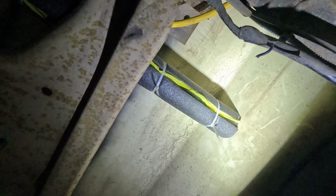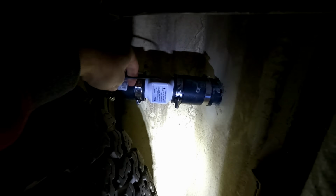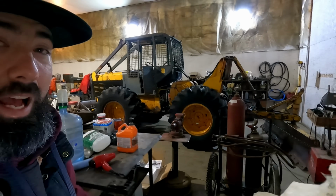So this has been a whole lot of trial and error with heavy focus on error, unfortunately. But this is my tube coming down. It's all nicely insulated. And rendition number 1, we just had the tube going back to the compartments back here, and it didn't have enough pressure to blow the hot air all the way. So on Amazon I found this little 1.5 inch vent fan, and I wired that in to the other switch. This switch, I have to build some labels for them. Yeah, that turns on my little fan back there, and that blows a ton of really hot air right back into my compartment.